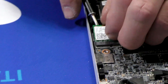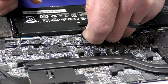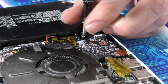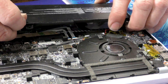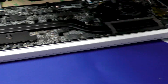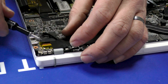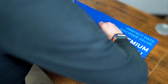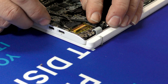Flip, pop that out. Then we will unplug the battery on this one — pull up and then pull forward a little bit. A screw for the motherboard. Here is another one from the motherboard, and then one hidden underneath the video ribbon cable for the screen, so we have to move stuff out of the way and remove a little tape that doesn't want to be cooperative.